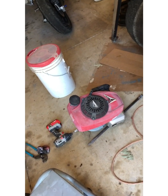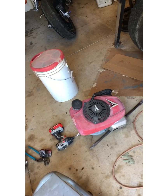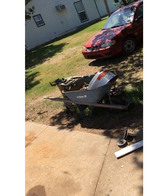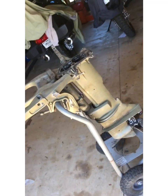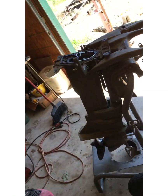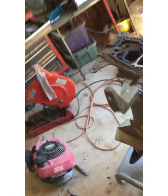I'm going to be putting that Honda motor on the Johnson lower unit. I brought the lower unit here and I'm going to try and mock it up and get it to line up. I need to think about orientation — if it tips up I don't want oil from the crankcase going into the cylinder, so I may turn it sideways. I'd really like to have the muffler sticking backwards so I'm not hearing it while driving.